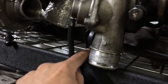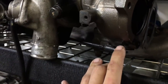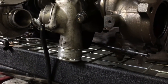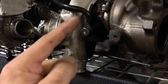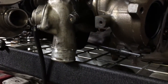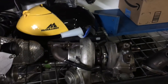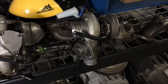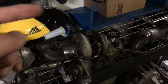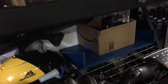To increase boost you can go with higher spring pressure for more preload, but the downside of the actuator is it will taper down at the top end. It makes peak boost and peak torque but then tapers down toward higher RPM. For example, targeting 20 pounds will drop to about 15-14. Stock spring makes about 8-10 pounds; a generic tune does about 17 and drops to around 12.